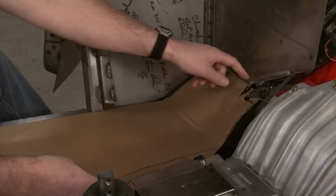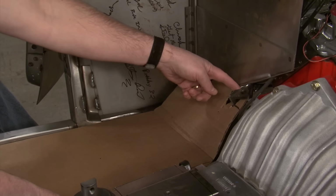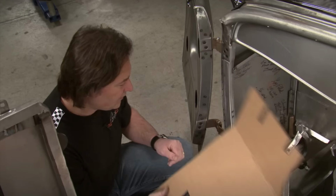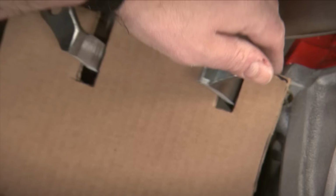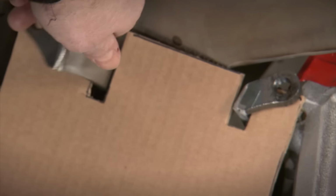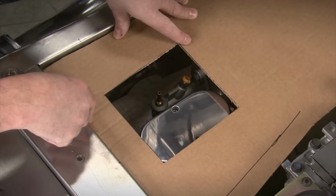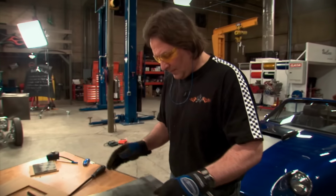Another option, if the vehicle has a frame, is to relocate the pedals down on the frame rail using a universal pedal kit. Now, this will require time and engineering to get the pedals in the correct location under the floor, as well as floor modifications for the pedals to come through. Since the pedals are on the frame, the master cylinders will need to be located down on the frame as well. This will require an access panel in the floor as well.